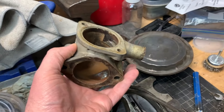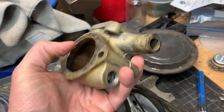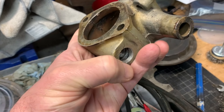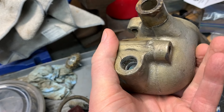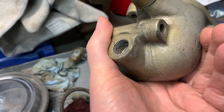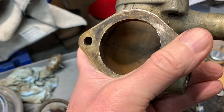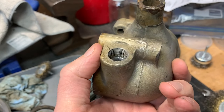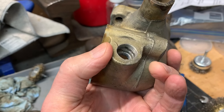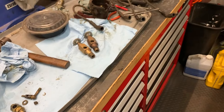I've been working a little bit on the cooling system. This finally is starting to clean up okay. I was having trouble with the fitting for the temperature gauge. You can see there's just still a little bit of crud inside there, but I wire-wheeled through that and let it soak in vinegar for a bit to help dissolve some of that hardness, and it's coming up better. I don't have a tap that's quite right for that, so I'm just going to try to clean it for now.